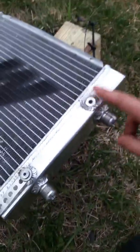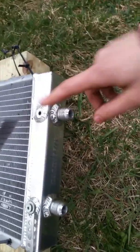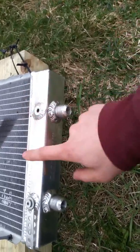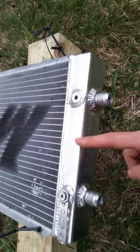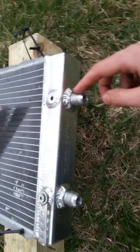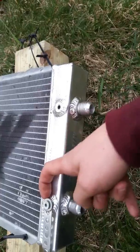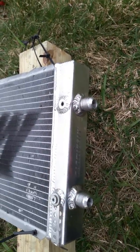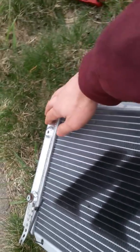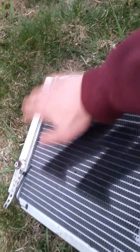My hunch is that this cooler does not have a diversion plate to force the fluid to actually flow through it in a dual pass manner. So if it had a weld seam right here, I wouldn't be questioning this. But since it's completely smooth, what I'm thinking is actually happening is the fluid's going in and right back out. I noticed this because when I'm running the cooler, it's completely cold — no warmer here than it is here.